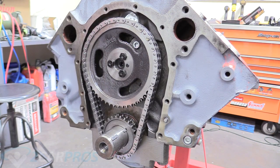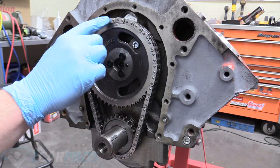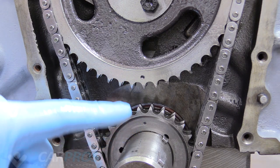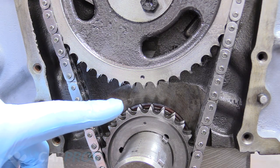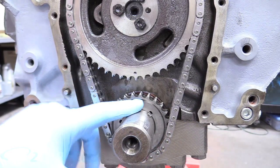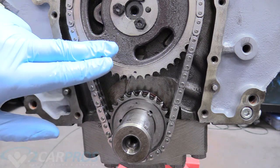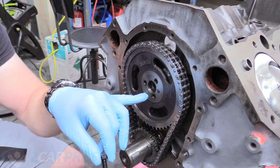One thing to point out is the tautness of this chain — it should be pretty tight when wiggling it. If there's any more slop than this, you either have the wrong chain or a worn-out chain, both of which are unacceptable. When lining up the timing marks, I've put some black Sharpie on the stamped metal pieces for visual purposes, but they should line up perfectly. There should be four holes basically in line: the crank bolt hole, the timing mark for the crank, the timing mark for the cam, and the cam center — all in a perfect line. If it's off slightly, you might be off a tooth, so pull the gear off and try again.